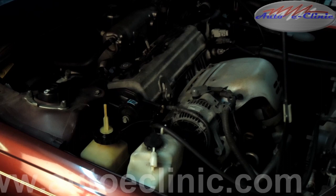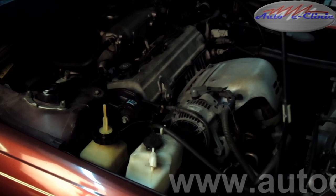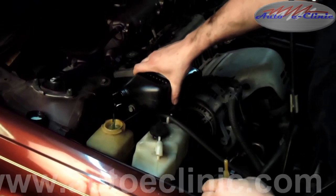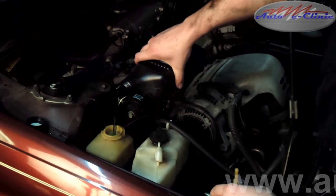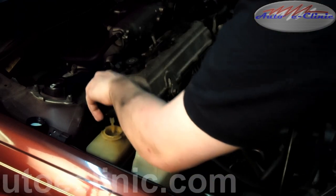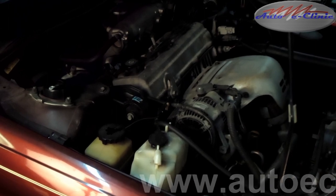We're going to start the vehicle and add power steering fluid to it. You're going to have a lot of bleed procedures that people are going to tell you about. The easiest I've found is just pour it in and turn the steering wheel. Go drive it afterwards — take it around the block. You should have all the air bubbles out of it in just a short trip. Verify there's no noise and the repair is completed.